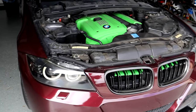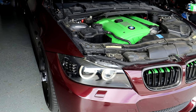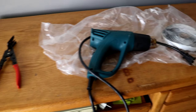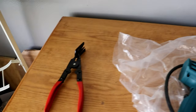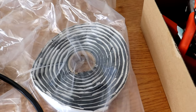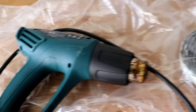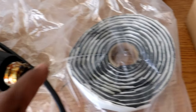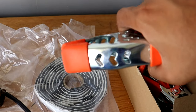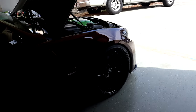So that's what I'm going to be doing. I'm going to be taking off this headlight so I can reseal the lens and maybe show you guys some of the stuff inside the housing. These are the tools and materials I'm going to be using. I have this little tool here that helps pry apart the lens and the housing, and I have some new headlight sealant material — it's like a rubbery glue type of material that softens when you heat it up. That's why I have a heat gun also. I'll soften it up, then clamp the lens and housing together with clamps until it cools down and hardens. With that, let's go ahead and start removing this headlight.